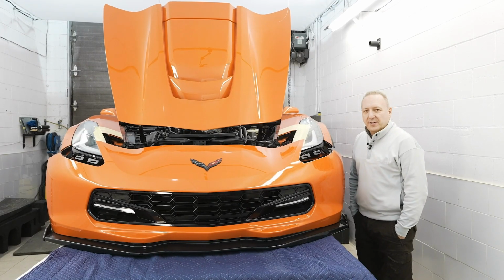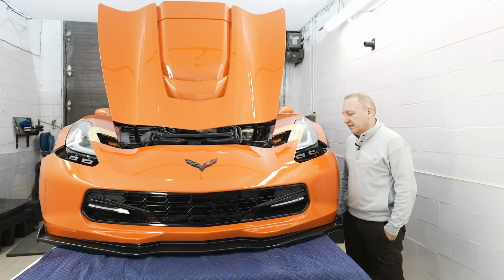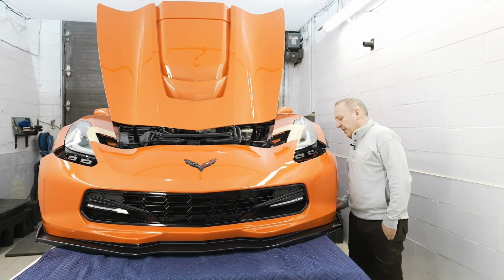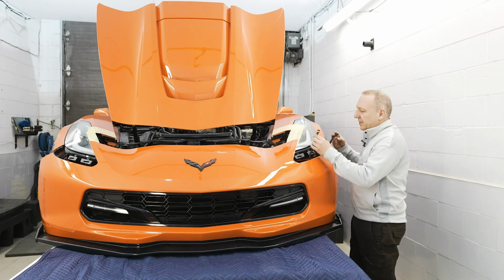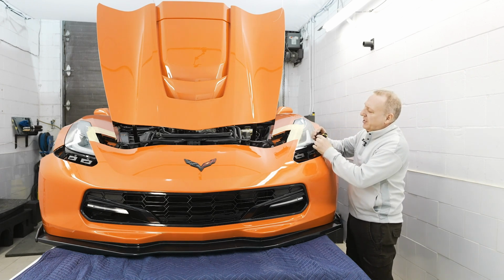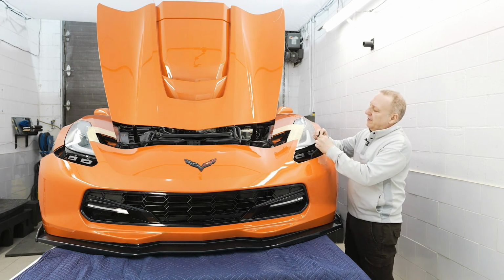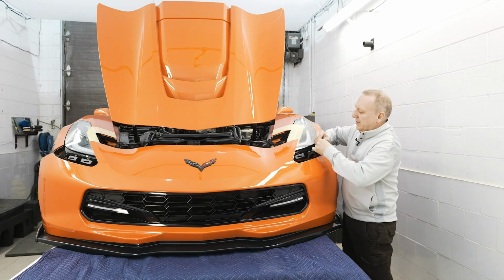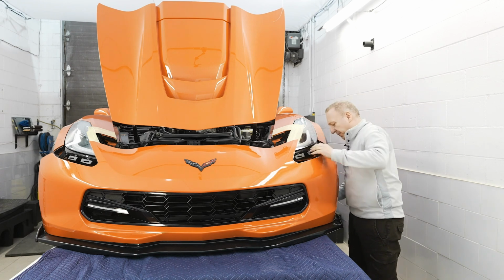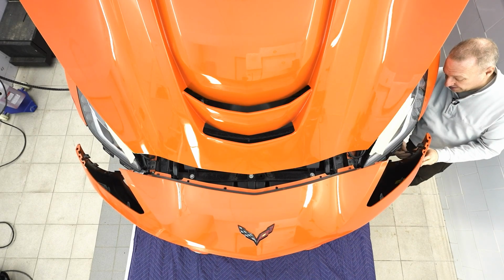We've made it to the last part, the final assembly. I have my bumper assembled with our new LED lighted grill. And the most important thing now is to do our final test. I have my harness for the lights themselves. I'm reassembling them, making sure my pins are perpendicular and straight. If they're not, I would straighten them with a small screwdriver. Install it, make sure I'm at the right key slots. Snapped on. I have my side markers also to reconnect, so I can do that.